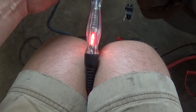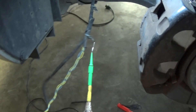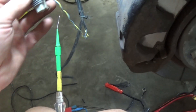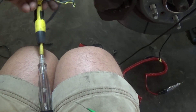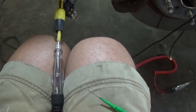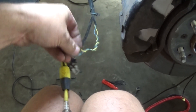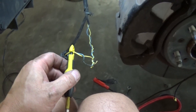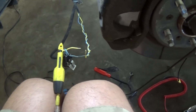I've got ground here as well — I guess it's close to the connector. If I touch the connector itself I don't have ground, so maybe it is my connector after all. I cannot pinpoint where it is — could be here. Actually, this looks soft... yeah, there you go — right there! There it is. What a nightmare.